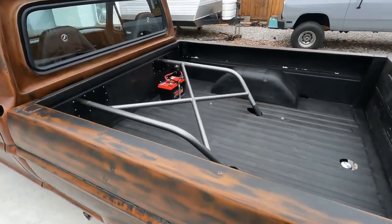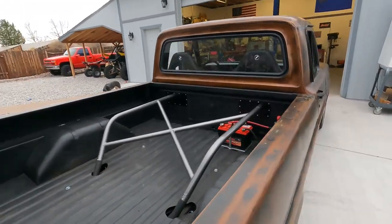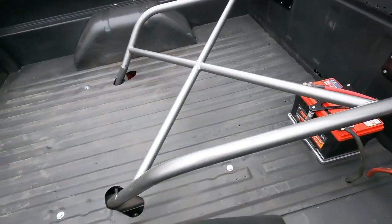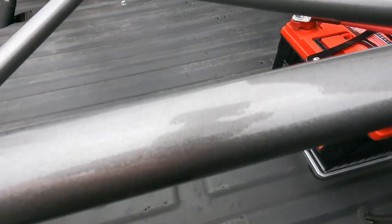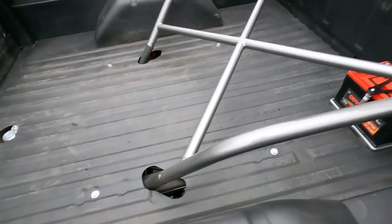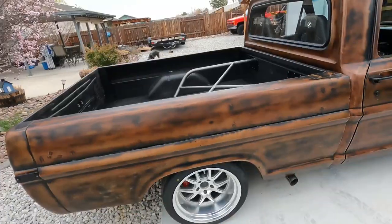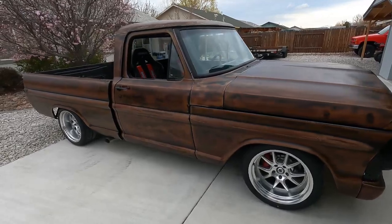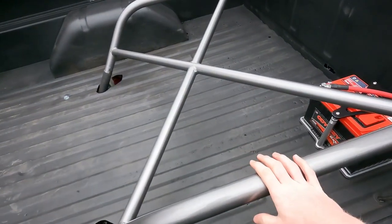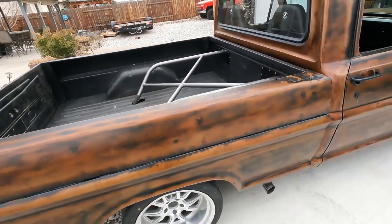Next we're putting in the little X-bar we made for the back. We got it all painted up — painted it the same color as the rear end and the inside of the frame. It's almost perfectly level with the bed and it looks killer in here. It's a quick-disconnect cage so we can take it off if we ever need to remove the bed. This definitely helped us out a lot on the autocross track — it should make the truck a lot stiffer, because the frames on these things aren't super strong and our Currie one kit can only do so much.